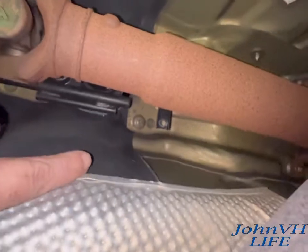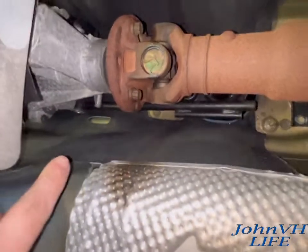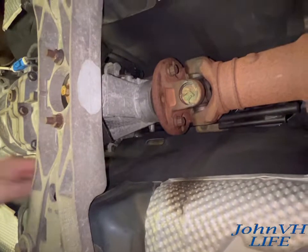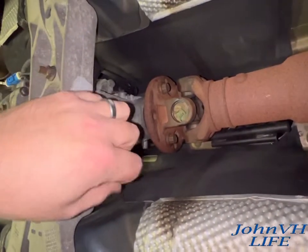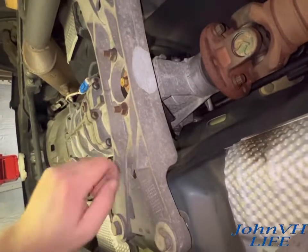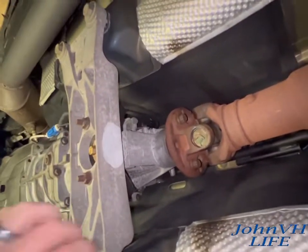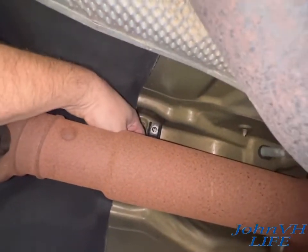Down underneath here you need your 10mm on a super long extension — you're going to get these two bolts that hold the rear mount, one on each side, very easy to take off. Then up front there's a bolt that holds the front mount — I took it out already. It says to use a ratcheting box end but I just used the open end and got it loose then reached in by hand. I lowered the mounts a bit — they don't seem to go as low as the guy in MGW's video says they'd go, so we'll see if that's a problem.